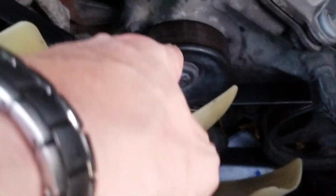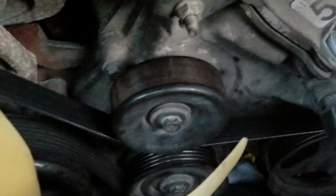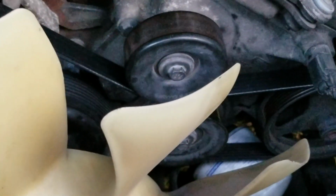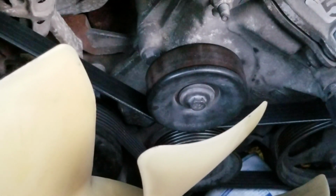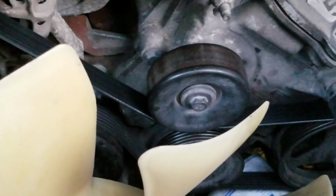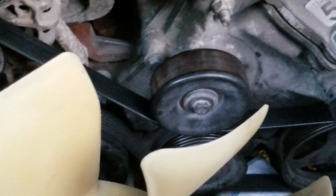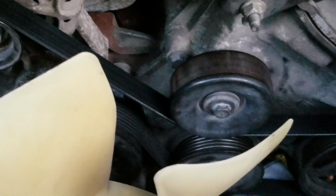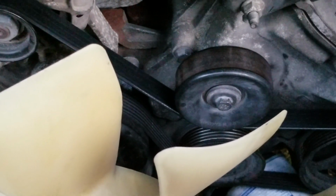The way I did it is I took that idler off right there, and the belt was sort of taut across there, and I used that idler when I pushed it over the bearing, because the bearing race seats out where the bearing seats on the block right there. There's a protrusion where the bearing sits over, and that's what the bearing rides on, and it's pretty easy to slip it down over that. And so I used that to get the tension on the belt.